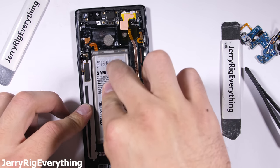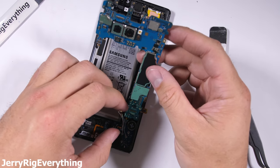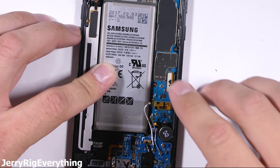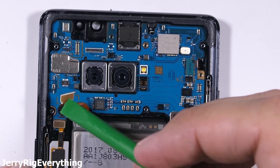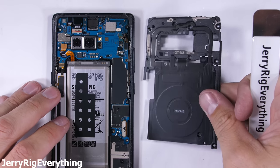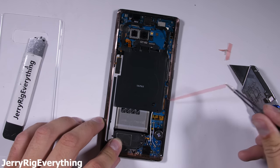Assembling the phone requires that 3300 mAh battery to go back in its slot, along with the charging port getting all 4 of its little screw holes lined up with the frame, including that functional headphone jack. The little charging port connector gets clipped to the underside of the motherboard before the whole thing gets laid down into the phone's frame. I'll pull up any extra ribbon cables underneath to make sure nothing is caught when I screw the motherboard back in place with that one tiny screw. The screen ribbons get snapped in like little Legos along with the headphone jack ribbon. Then the white and blue wire cables get plugged into their circular connections. There are 3 ribbon cables attached to the top side of the motherboard, then I'll plop in the front camera and iris scanner back into their slots, clicking them down into place. The last thing I'm going to plug in is the battery. Once the battery is connected, I'll plop the loudspeaker plastics and the wireless charging that rests on top of the motherboard back into place. There are 16 screws holding everything together. Normally I would have to plug in the fingerprint scanner at this point, but since I annihilated mine, I get to skip that part. Then finally the glass gets put back down over the top.